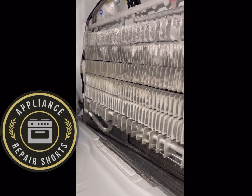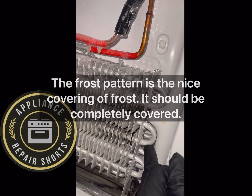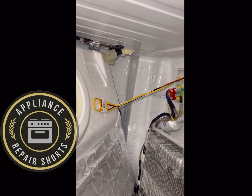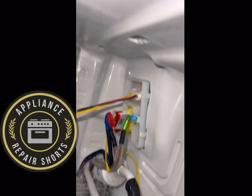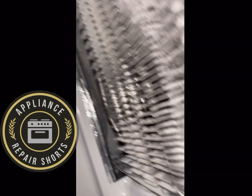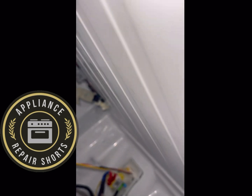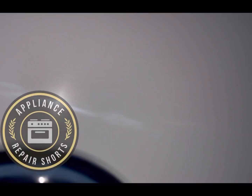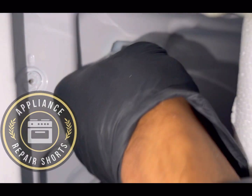The frost pattern is actually looking better — definitely looking better. You can see where things are frozen; all of that is frozen. When you have low refrigerant, the frost is just going to be at the top. This is a twin-cool system, meaning both the fridge and the freezer are responsible for their own cooling. I'm going to unplug this fan and see if it's a sensor issue or a fan issue — sometimes it's just a bad connection. My main thing is I want to see that fan kick on.